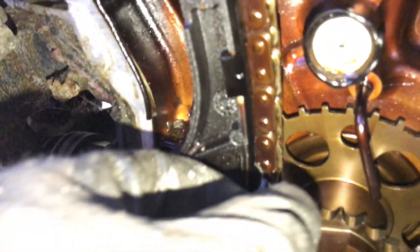The timing chain was kind of loose on the left side and super tight on the right side. There's a piece of something — I think these little circular pieces are just part of the silicone or whatever seal they used around the bolts.